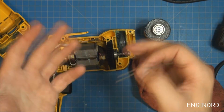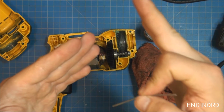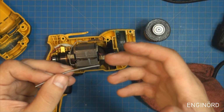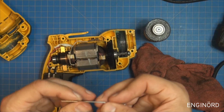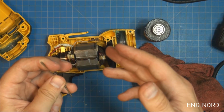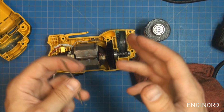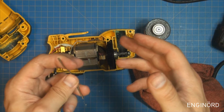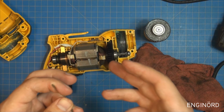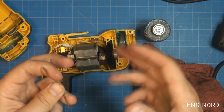So when you have a gear made out of steel and you apply a load, that gear tooth is going to bend, and if the load is higher than the yield strength of the material, it will create a permanent deformation on the part. Now, typically if you look at material properties, you can see what the yield strength is and what the ultimate strength is. So if you have a material where the yield strength is 200 MPa and the ultimate strength is 350, then you have a little reserve. Okay, so it will plastically deform before it fails.